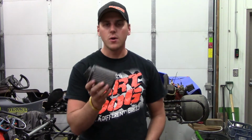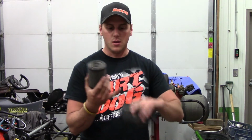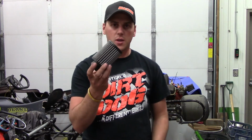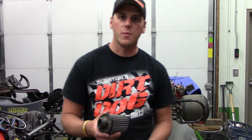You have to oil these things. You're running a fabric air filter, whether it's the 206 Briggs & Stratton stock one, the aftermarket one that I sell, or any one of the newer ones. They have the new fabric ones from SMB, K&N, whatever you might have. You need to oil it.